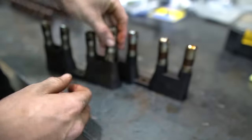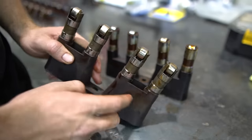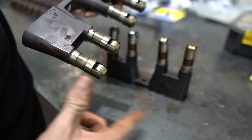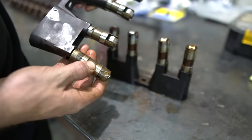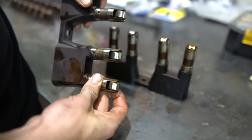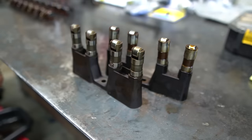The lifters are really not that expensive — it's like $100 to $120 for a set of lifters and trays for your entire engine. The lifter tray itself can also break. The lifter has two flat spots that locate it in the tray, keeping it in the correct orientation for the cam roller to work. If the lifter turns sideways, you don't have a rolling contact — you wipe out your cam lobe. The older trays can break, leaving the lifter in a smooth bore where it can spin and wreak havoc.